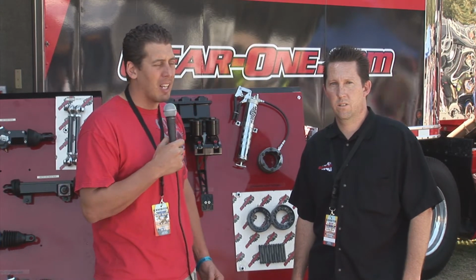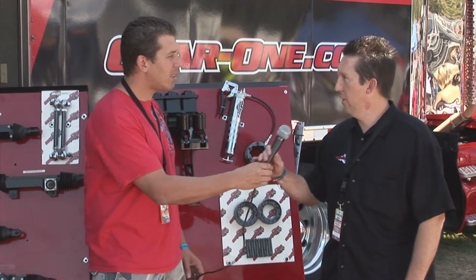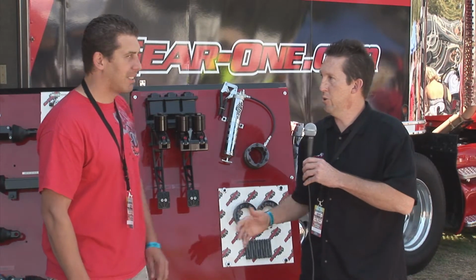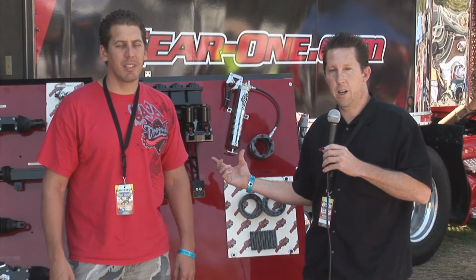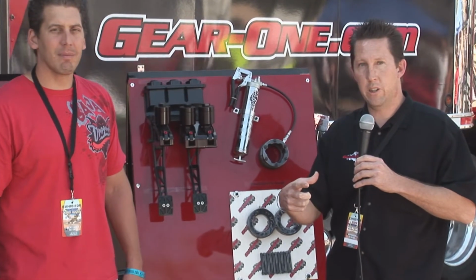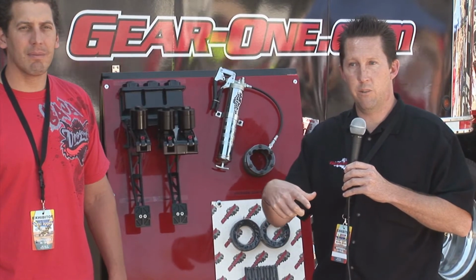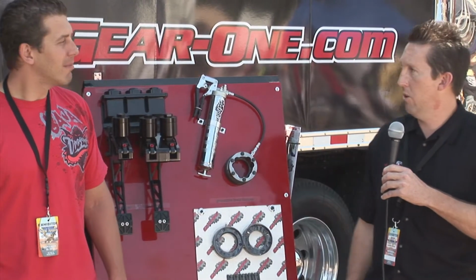So I'm going to have Keith talk about some of his new technology that I quickly grazed over, and then move on to some of his new short course products. Thank you, Todd. One of the things that you're running now in the Class 1 car is a dual pivoting master cylinder setup that has a spherical bearing at the rear, so that allows us to have a one-piece piston and rod which produces no negative pressure, and it works out really well when you adjust your front to rear brake bias. It's real smooth, as you know, Todd, right?